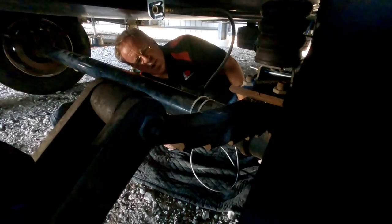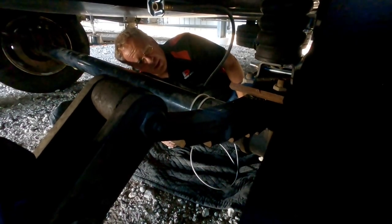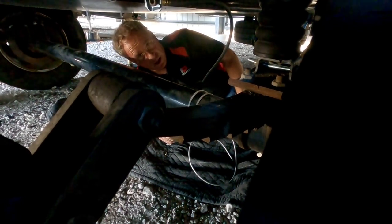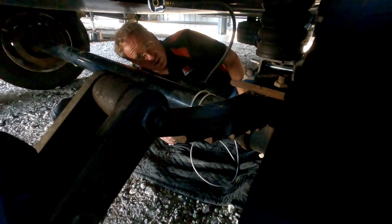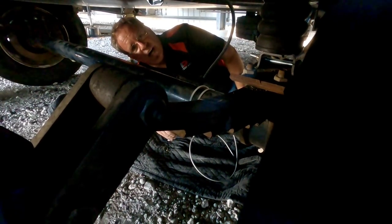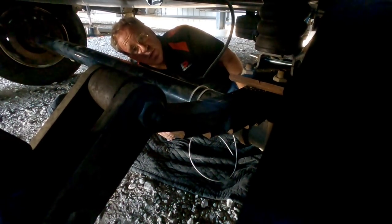On disc brakes it's much more like a late model vehicle — you can just look at how your brake pads are wearing and look at the wear surfaces of your rotors, and visually see how things are wearing. Dexter still recommends every 12 months that the bearings be inspected, repacked, and end play reset, but it's a much simpler job. With disc brakes you can also physically see the wheel bearing seal on the inside — if the seal's not leaking, everything is good. With drum brakes, of course, it has to be fully disassembled for inspection.